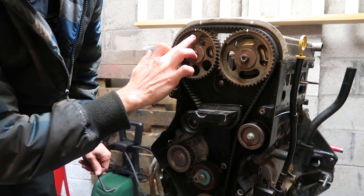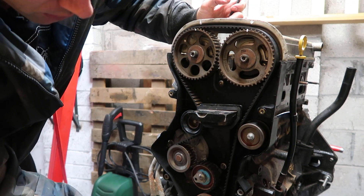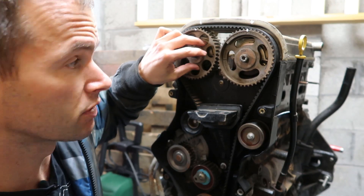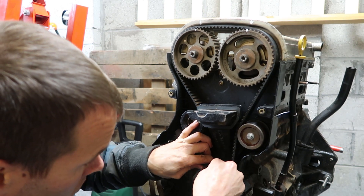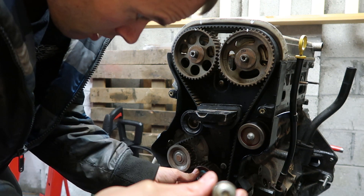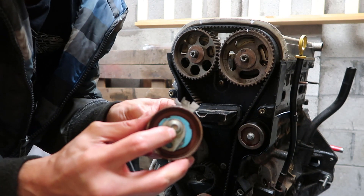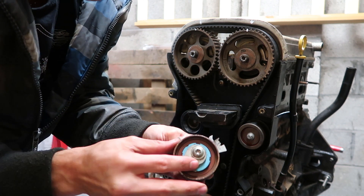I like to time it up before I do anything — those are the timing marks on the Vectra. It's quite an easy motor to work on; the camshafts have no variable valve timing, all just fixed solid, which makes things easier. That's the standard tensioner bolt and they often give trouble because they strip out on the torx drive, so you can get an upgraded one which is just a normal hex socket.